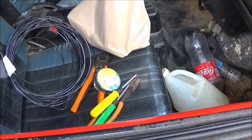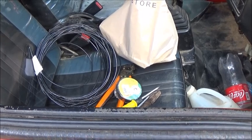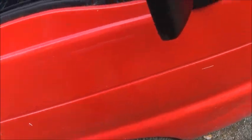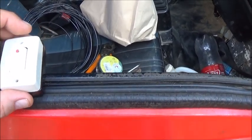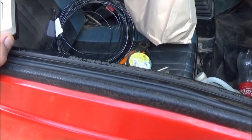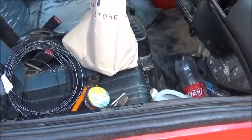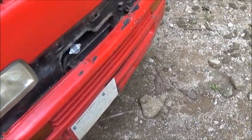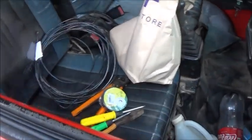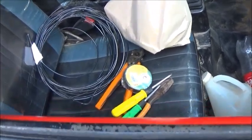Welcome to Foreigner Farming in the Philippines. I searched underneath and tried to find the ignition hot wire and I can't find it, so I'm going to wire the fan motor in on this red van with a switch. I couldn't find a toggle switch at any of the three auto supply stores I went to yesterday that would handle the amperage — they all had toggle switches but only 5 or 10 amps at 12 volts. I'm sure that blower fan is 30 to 40 amps, and a 5 or 10 amp toggle switch would just start melting in about five seconds, and this needs to run continuously.